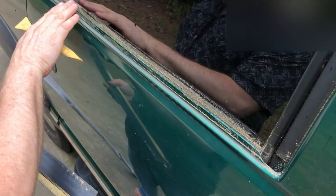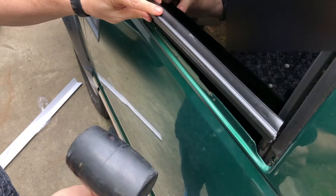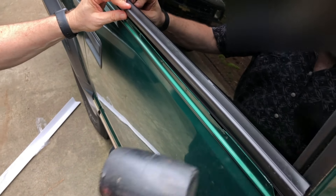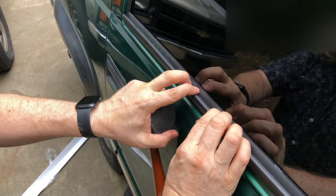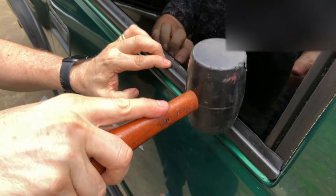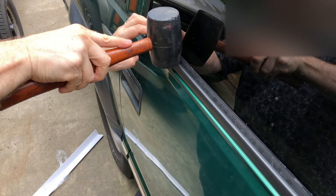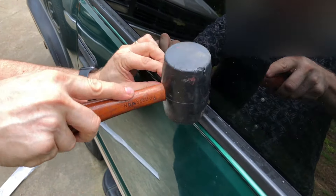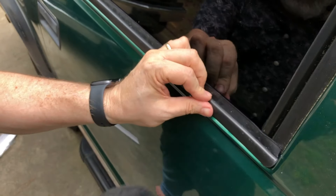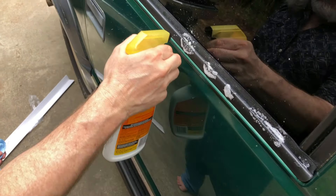The felt is all impregnated so we just need to clean this off before we put the new one on. Just like last time, we're going to take some vinegar-based glass cleaner and clean off the accumulated road dirt and tree pollen. We've got this one all cleaned off now. We're going to take the second of our pair — again, just line that up in position. Remember, the felt side always faces the glass. I'm going to use a mallet this time just to show you the other technique, though we'll get it started by hand first.